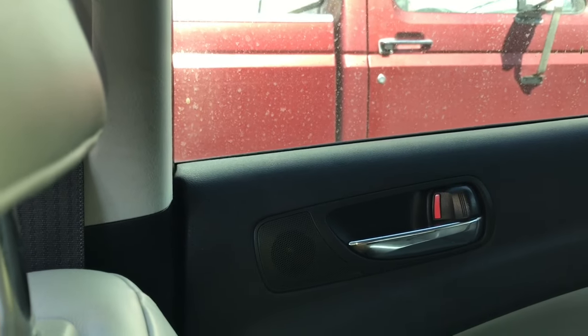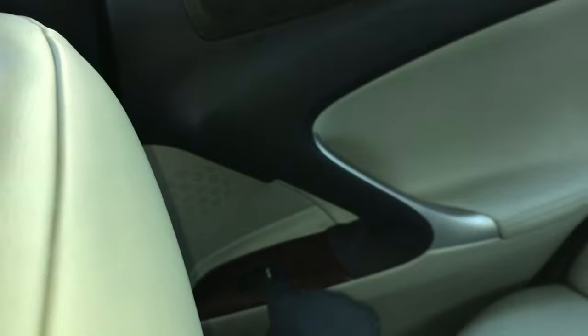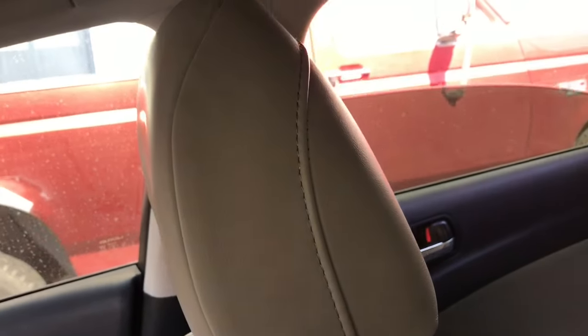Hold it at the top for three or four seconds: one, two, three, four. Now check it here — tap it once, window rolls down. Tap it once, window rolls up. Then go back to the master switch, operate it, and the window went down. Operate from the master switch, window rolls up.